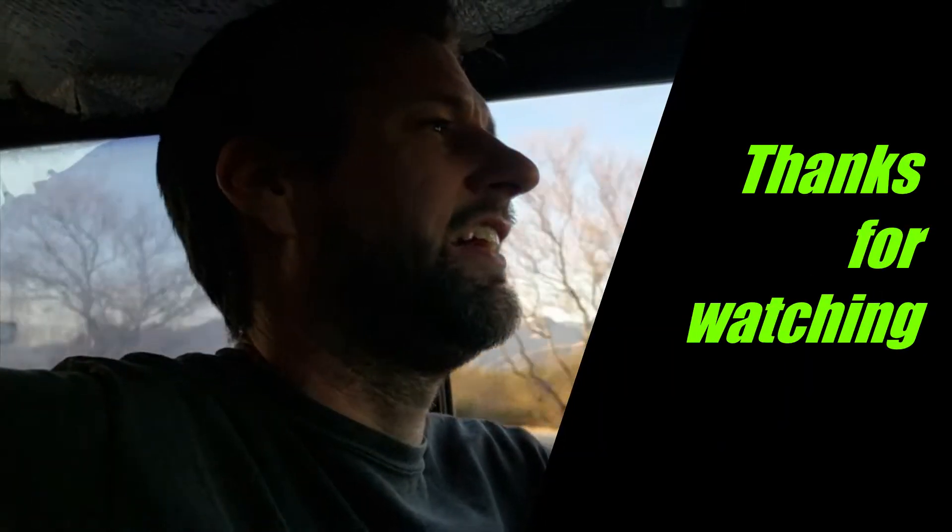Got it out of the driveway - let's see if I can swing this corner. Man, I forgot what boost feels like. I need to figure out what that diesel whine is - it comes and goes. I'm pretty sure it's just the idle air valve coming in and out when you lift off the throttle, it snaps to a known position. Have to grab the kid and do a drive around the block with the laptop to check AFRs, but yeah so far everything's working. Yeah, definitely business.